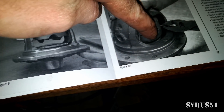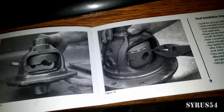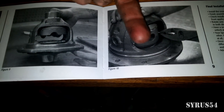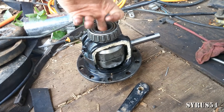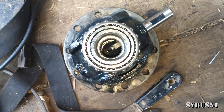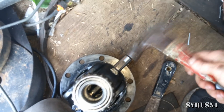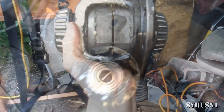As you try to push the pin in through this hole, you're going to find that the back side of this center spacer is pressing out, and it's a little bit difficult to try to pound that pin in there. What I did was I set mine with one side facing down, stuck one finger in through the top, grabbed the other side of that spacer, and pulled the top one up. Then I hit the pin with a hammer. One finger in, grab the side of that, pull it up as high as you can — gravity will pull the other one down and give you just enough room to tap this. Don't pound it in with a sledgehammer; nice and gentle, tap it in. Make sure you go slow when you're tapping this because if you've got your finger down in there, you will mash it. And there you go.